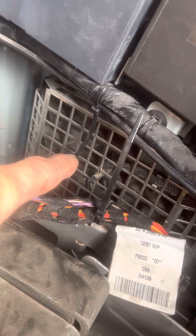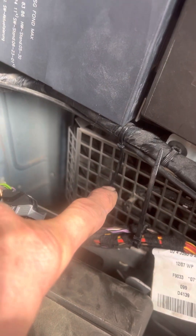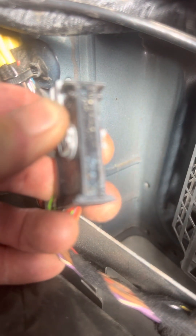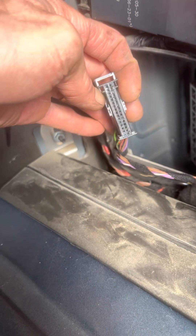You're going to get moisture coming through here — I don't know what they call these, but it allows a bunch of vacuum pressure in the trunk with obvious moisture coming through there. Look at your connector. That's the fix right there. This is a parking aid module — it's a thousand dollar module. I'm going to replace that and fix the wiring there.